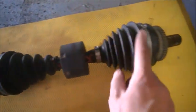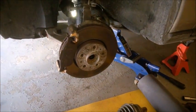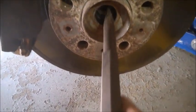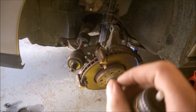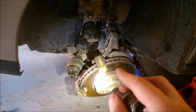You need to have this damper boot — also made by GKN. But the first thing, before you want to remove any bolt, remove the center bolt. It's 40 millimeter and has to be replaced because it's a stretch bolt. See if you can push your axle back in a little bit, see if it moves. Especially on the XC90, it can get stuck. Sometimes the dealership will put thread lock on because this bolt gets loose and they have problems with anti-skid messages.